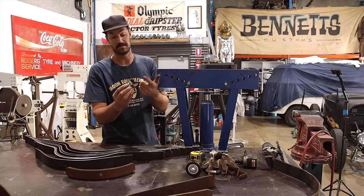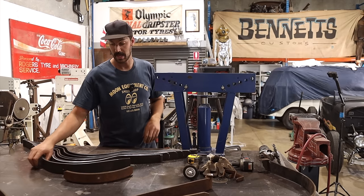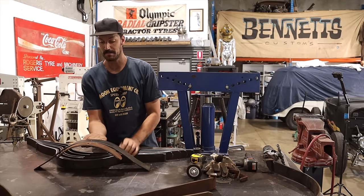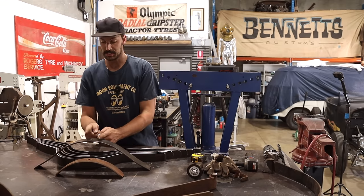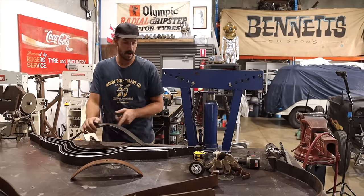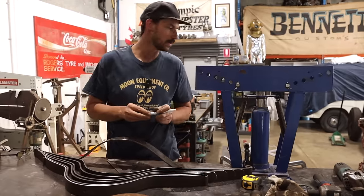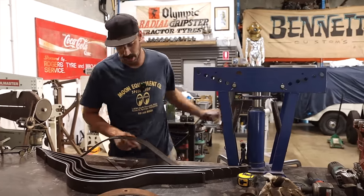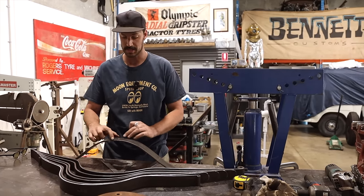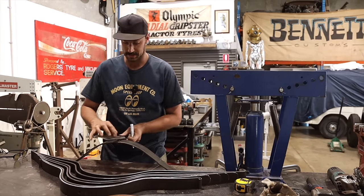So I've made this little cup — I just TIG welded a tiny little piece of flat bar and just radiused the edge so there are no harsh edges contacting anything. That sits on the top of the bottle jack. These have obviously two different curvatures, so I need to try and match the Model T one. I'm just going to put it in and do a couple of little tweaks on both sides — you want to make sure you do it evenly. What I usually do is mark out a few lines. You want to try to avoid any area around the hole where your pin comes through, because there's obviously a stress point there. If you go and try to tweak that, you could easily just put a crack in it. So that's roughly center.